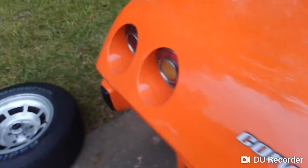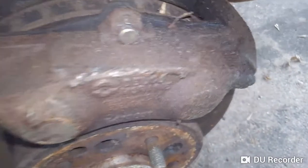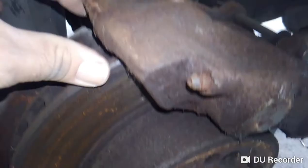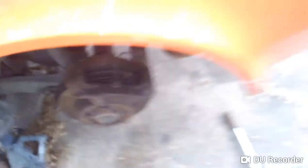This one looks good. Now as we get over to the other side, you can see how grungy this one is — the body is all rusted and nasty. What happens when brake fluid hits a metallic surface is it corrodes it — brake fluid is highly corrosive. You can see the rust all over it. This is our culprit: a leaky caliper.